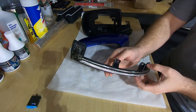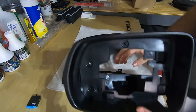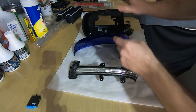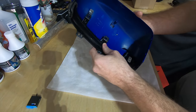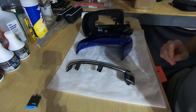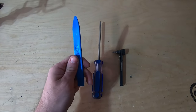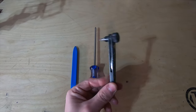All OEM, all original, all brand new. What I've noticed is that in order to get the light put in place, these two pieces have to be separate, which means I'm going to have to take them apart on the car as well in order to get the cap on. It also gets screwed on to the light right here, so all these pieces come together before the mirror is put back together. The only three tools you'll need are a plastic pry bar or trim panel removal tool with a sharp pointed tip, a long Phillips head screwdriver, and a ratcheting screwdriver with a Phillips head bit.